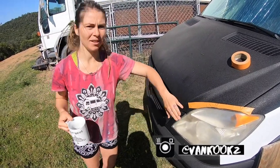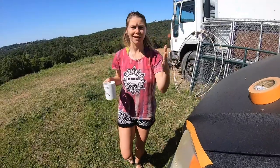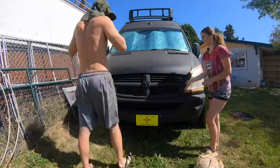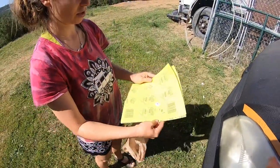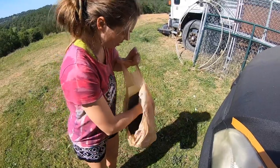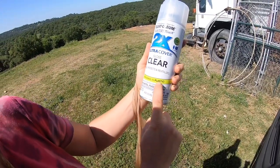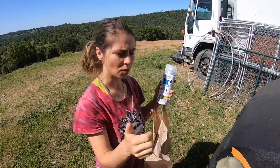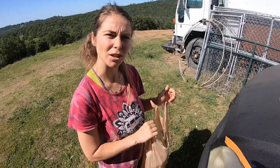Welcome back to the channel. Today we're going to show you how to get these ugly oxidized lights into some clear, almost brand new lights. We're going to spend $10 pretty much instead of $200 for a light to make them look like new. You'll need 400 grit, 600 grit, and 2000 grit sandpaper. You'll also need a clear gloss that seals, protects, revitalizes, bonds to plastic, is non-yellowing, and UV resistant. You'll need alcohol to wipe down the lights, and some car wax.